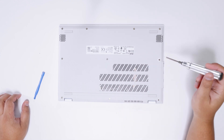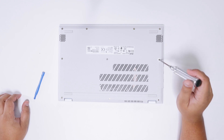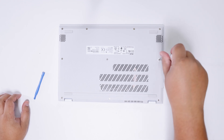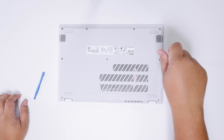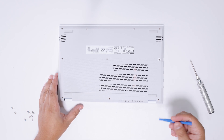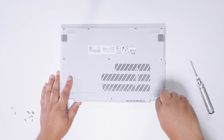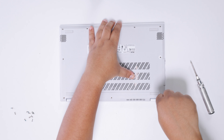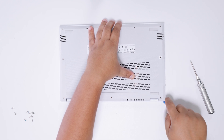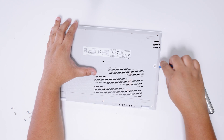Let's pop it open and see what's under the hood — something pretty interesting that I discovered here. There's a bunch of screws to get into the back. You'll notice that Asus has one of these stickers over one of the screw holes basically saying if you open this up, you're going to void the warranty. Do it anyway if you want to get in. You can't just pop the back case off — you need a spudger or a guitar pick to pry the plastic open. Don't use a metal screwdriver or you will damage the casing.